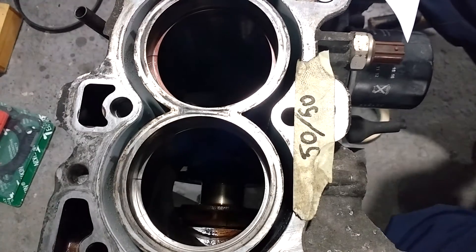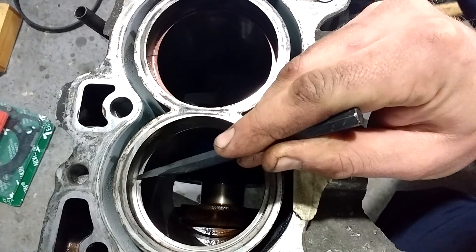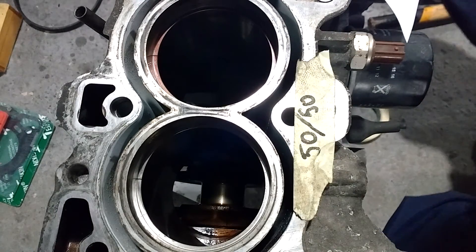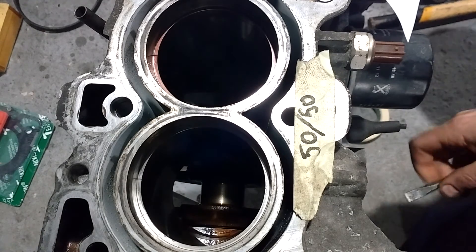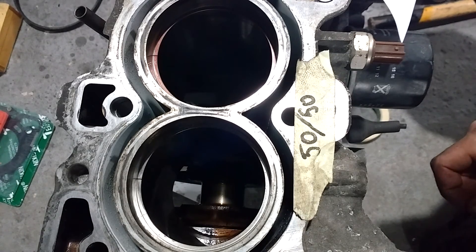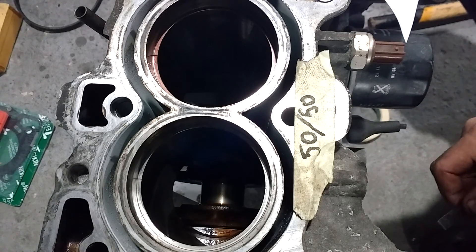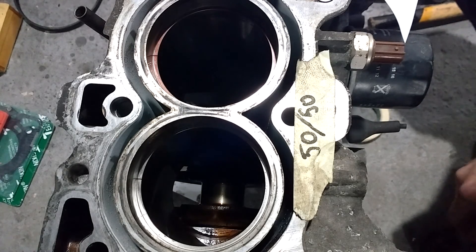Looking at the minimum compression ring gap, it indicates a lack of production wear compared to the gap in a new piston ring — visually identical. Therefore, replacement of the rings in this engine is not necessary. Conclusions: mechanical cleaning of soot is 100% effective and long-lasting; chemical treatment may help but not in all cases, and the result will not be long-lasting. Next will be assembling the engine and running it — you can see that in the following video. Subscribe, like, repost, and good luck — goodbye!